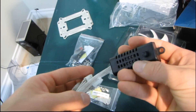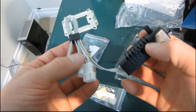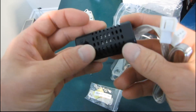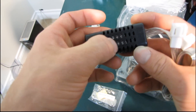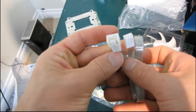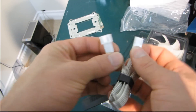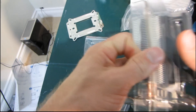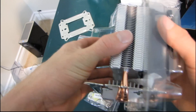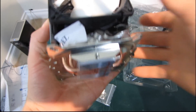Here's the included fan speed controller — I've seen these in a number of different heat sink solutions, so there's probably some OEM that makes them. They work really well. There's a hole in the controller because there's a little heat sink inside that gives it some ventilation for the heat it kicks off. You just plug this into your motherboard, plug this into the fan, and then you control the fan speed. I'll probably plug this into my test bench so we can hear how loud the fan is.